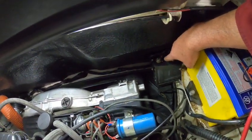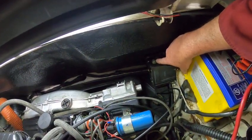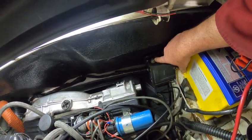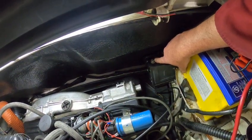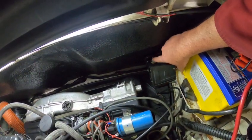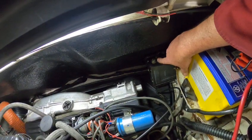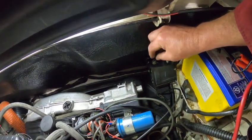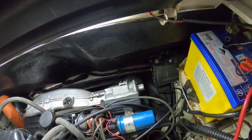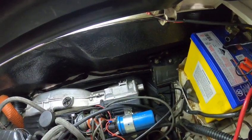So it's the ECU there, which actually has a mixture control knob or adjusting knob on the end of it with about one and three quarter turns of adjustment. That's all calibrated with notches on the actual knob, so it'll only go click, click, click. It has quite a few different settings and each one is usually quite a noticeable adjustment.